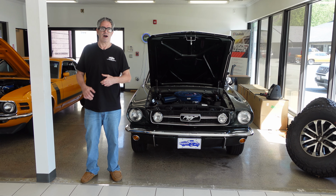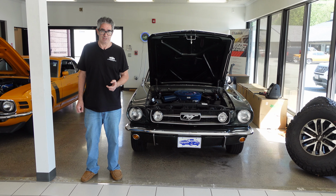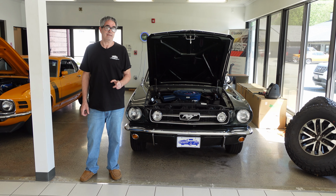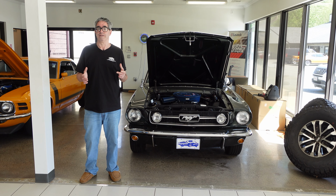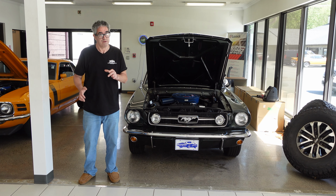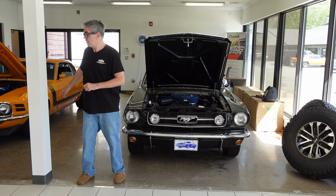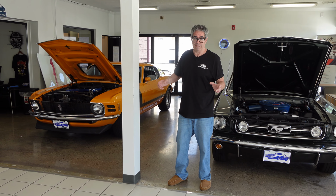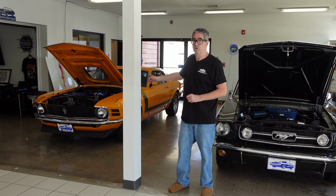Now, the Mustang was in its humble beginnings in 1966, having arrived midway through '64. This is a special one. It's a GT, which is about the pinnacle of performance and handling for a Mustang in '66, short of a GT350, which is a whole different creature. Meanwhile, the Boss 302 has a 302 cubic inch canted valve engine, 290 net horsepower. These are pretty serious road race candidates.